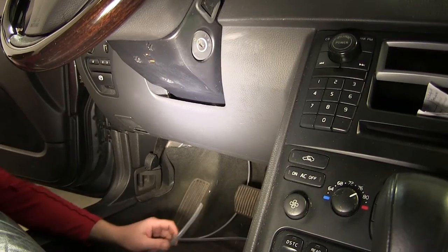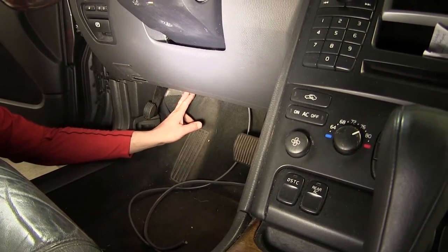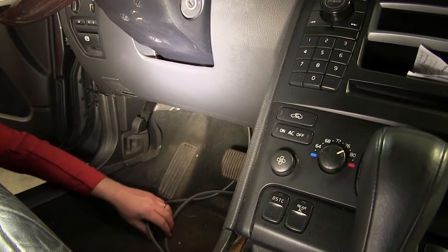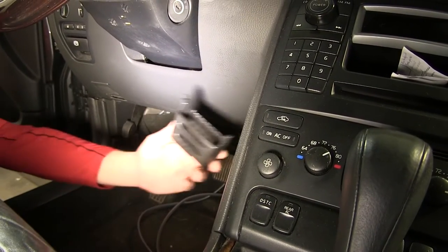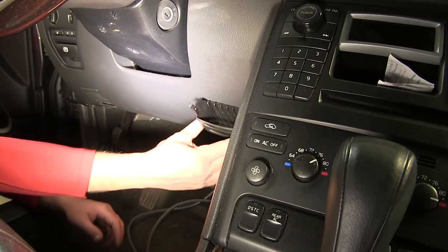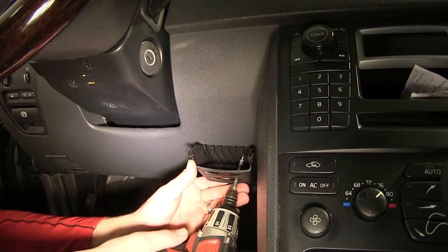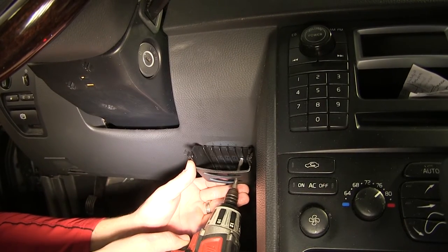Now with our gray duplex cable run underneath the paneling here, out the carpet, underneath the dash, we're gonna go ahead and let that set aside for now. Next, we're gonna mount our brake controller pocket. The pocket will sit here on the dash where it's accessible to the driver. Using the hardware provided, we'll go ahead and secure the pocket to the dash.